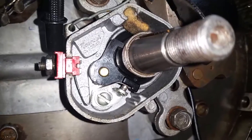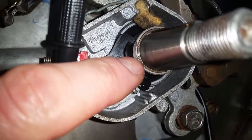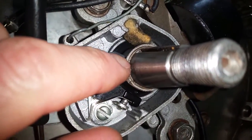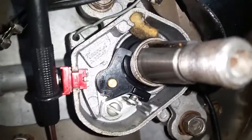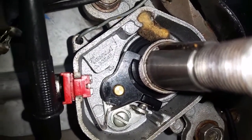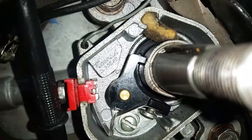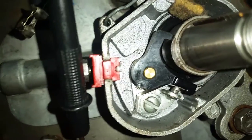I also wanted to add that there are some arrows you can barely see — there's one here and a set of three here as well. I'm not quite sure what the three marks indicate — if anybody wants to add that in the comments, that'd be great. But this single arrow on the side I believe is a mark that indicates your ignition timing, and when mine is properly set, the tip of that arrow is just about at the center of that contact arm. So if you don't want to go through all of this, that may be a good starting point — just line up the tip of that arrow in the center of your contact arm.